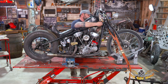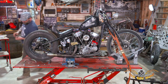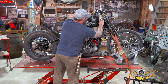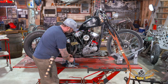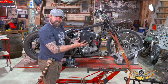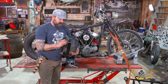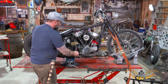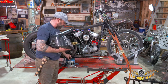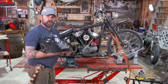Now that we got that out, I'm going to move back to the other side, take out that bolt, then I can remove the gas tank. I'll put these bolts in front so I know this is my rear set and that's my front set. I'm going to carefully wiggle my tank off — the tank comes off all in one piece. There is a lot of gas in this one so be careful you don't drop it; it does get sloshy. Then I'm going to take my nuts and bolts — the hardware — and put them right back on loosely. So when I go to put this back on I'm not scrambling for hardware. Just a simple little thing some people overlook when they're in a rush. It's a great way to keep yourself organized.